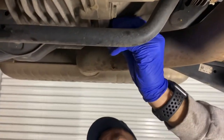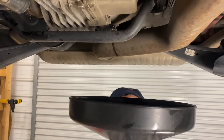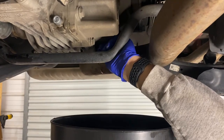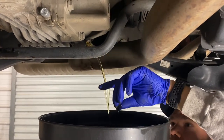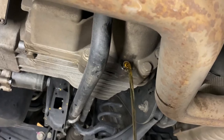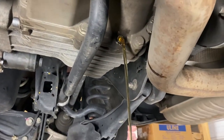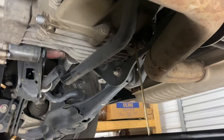This is the one - you can bring this up some to make sure you don't miss. Loosen this wing nut, bring it up. Don't want to have a fluid disaster. There is the gear oil drain and the fill port up yonder. So don't be like the VW Senior Master techs that drain one or the other and fill one or the other and don't do both.